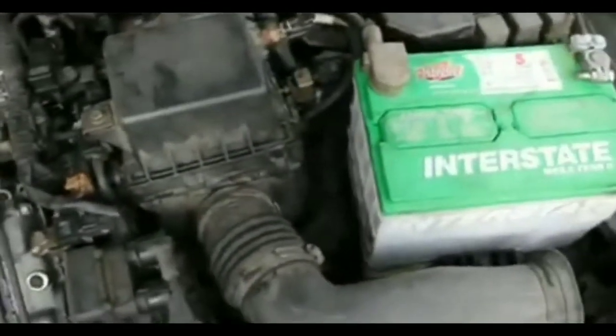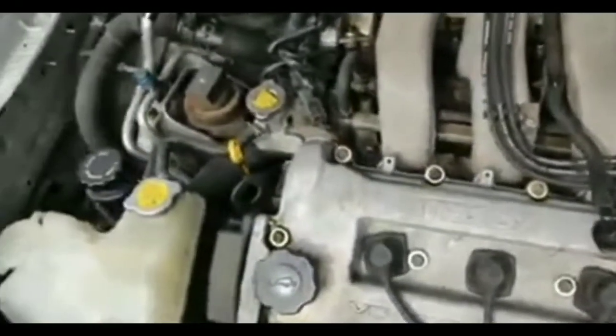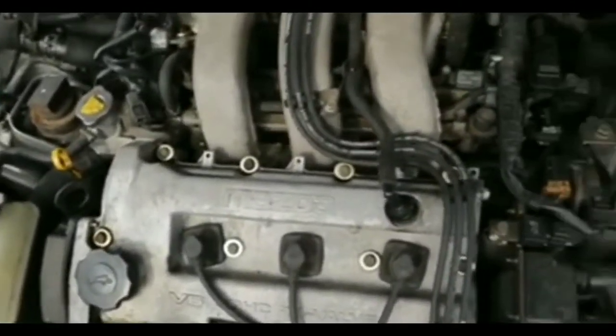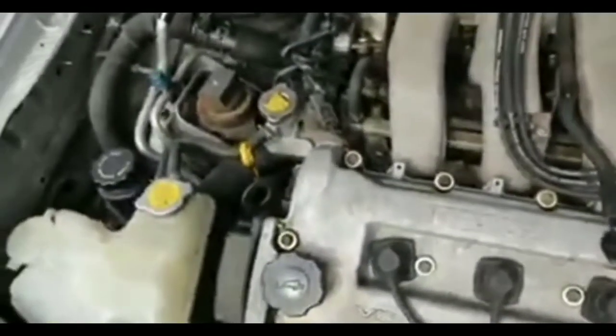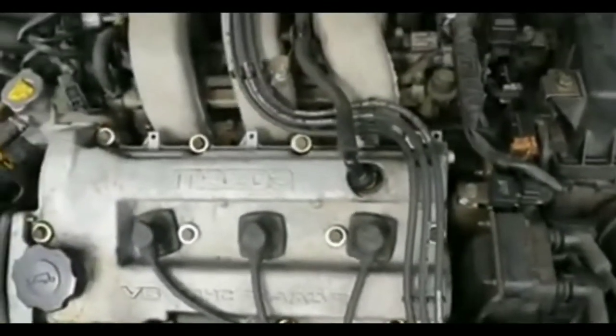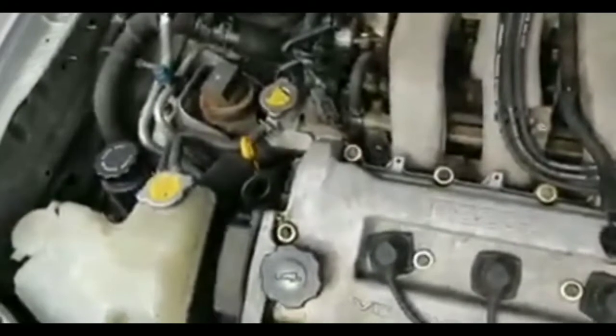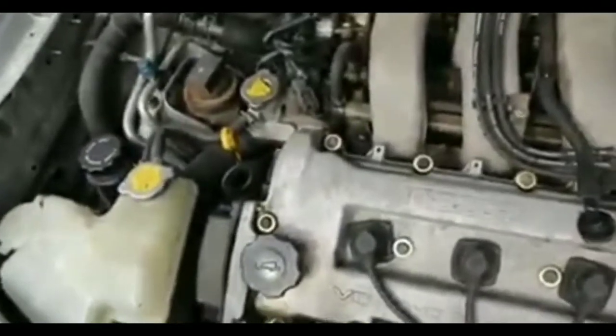The second time I had a fuse issue, there was a fuse to the fuel pump or the car's computer that blew. It would crank up, but it would not turn over. It would not start. Swap out that fuse, everything works. But unfortunately, that's not this case, because everything turns on except this car is not cranking up. I mean, that's the main problem here. And it's not the fuses, as far as I can tell. So what else could it be?